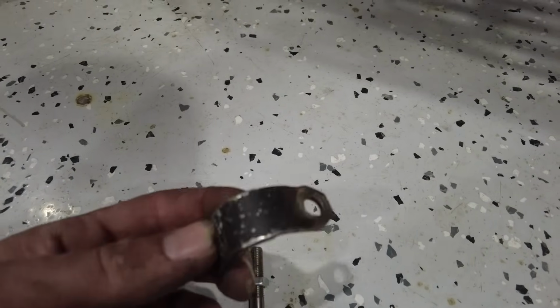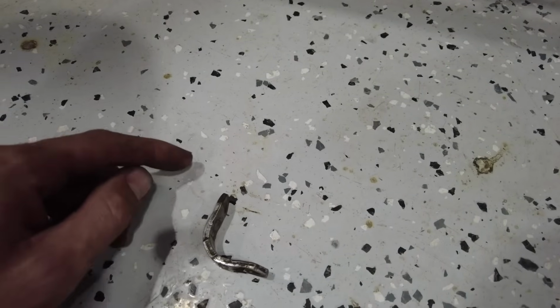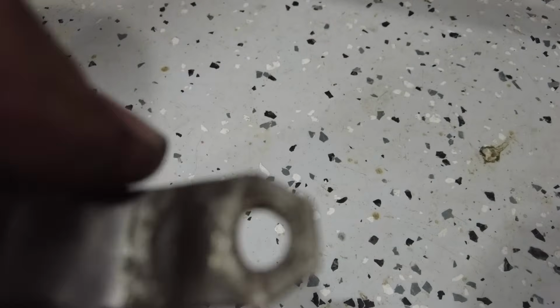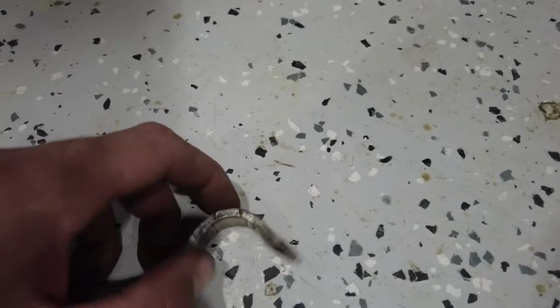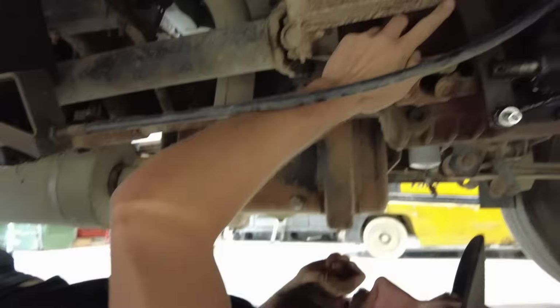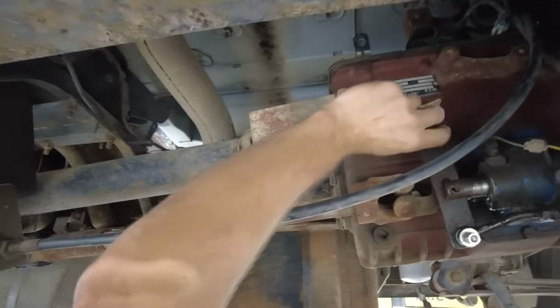So I went and grabbed a U-joint strap off of a one-ton Dodge and took it out to the vise. These were bent out this way because it goes over a U-joint and bolts to a pinion yoke. So I flattened them out, and I need to drill the hole out because you can see it's oval now. But this is the right size for that clevis pin to go in. So I'm going to lay a piece of stock in between here, like a piece of half inch bar, and fold these ends over, hopefully leaving enough room in the middle. It doesn't need to be that thick. You're just going over this plate, which is like an eighth inch. So if you give us a quarter inch in there, then we'll be good, because we hook in here and go to here.